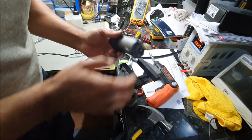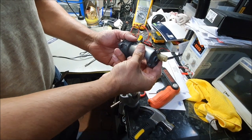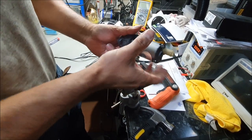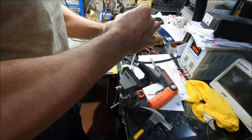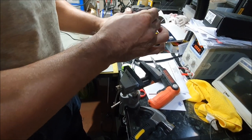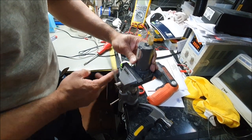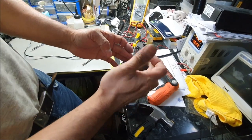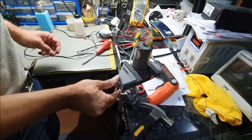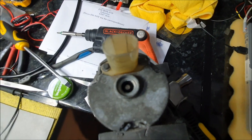Okay, so I'll inspect the unit, not pressing it too hard, otherwise you'll warp the housing. So do pay a lot of attention to that. I'm going to inspect it and make sure that this is okay. I still feel that I can tap it in a little bit more. The base is stronger than the housing, so you can put the vise on, but not with excessive force. I can see that this is not closed off fully.